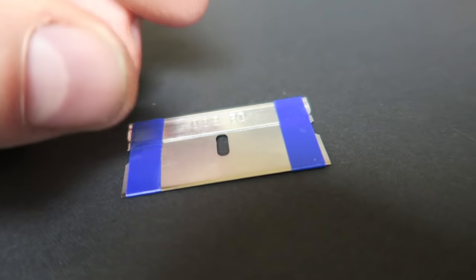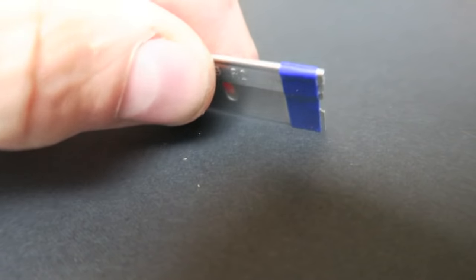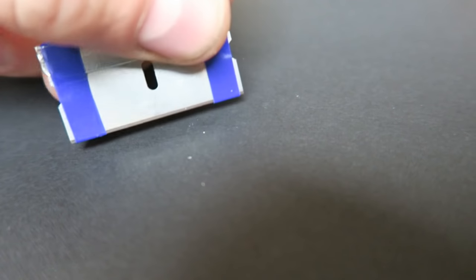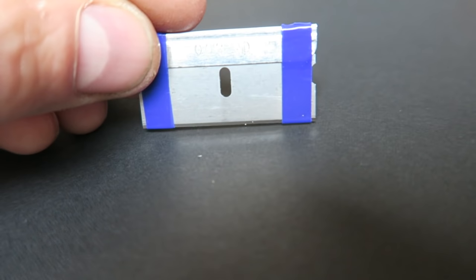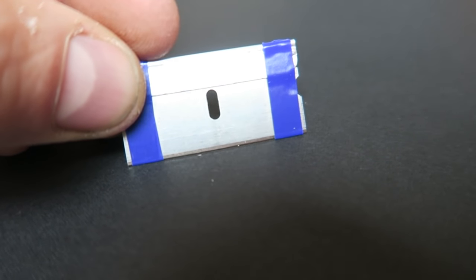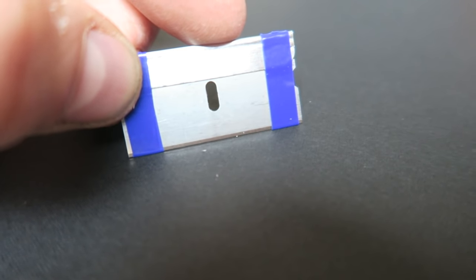Something that somebody else recommended along the razor blade route on my polishing video was to put some masking tape on each end of a razor blade and then draw it across where you've got a dust inclusion. This works really well because the tape lifts the sharp edge of the blade off the paintwork, so if you've got a bit of dust sticking up, the razor blade will take that piece of dust off, and only that piece of dust off, providing of course it's on quite a flat surface. So thanks very much for that. That was a real nice tip that somebody else dropped on me, unused by myself, but I'm sure I'll give it a go in the future.